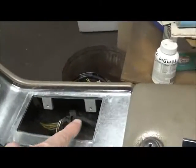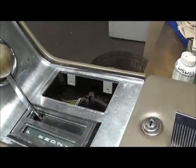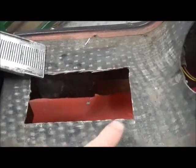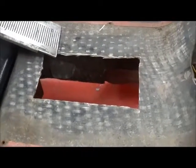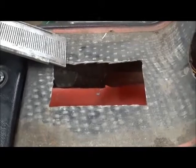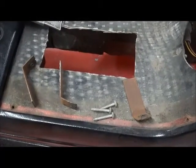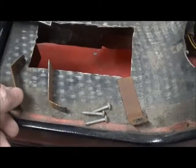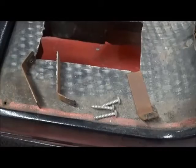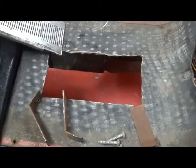This is a 1964, and if you'll notice, there are mounting tabs already cast into the console. But this is a 1963 — no mounting tabs. So what they did was use four pieces of metal and four screws, which is really much more difficult to install. Here are three of the four brackets. These are almost always missing, but they're not that hard to make yourself — that's what you need to secure the ashtray back in the console.